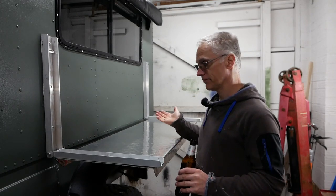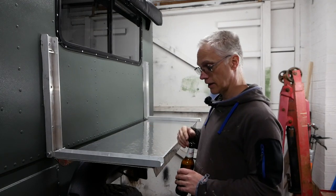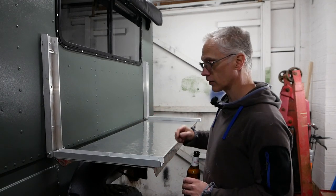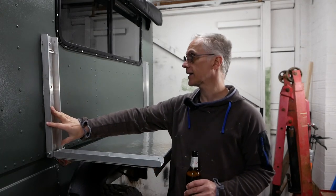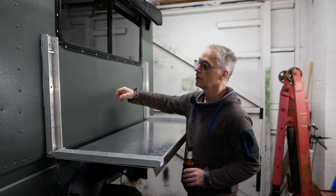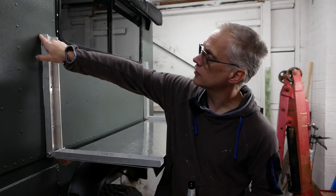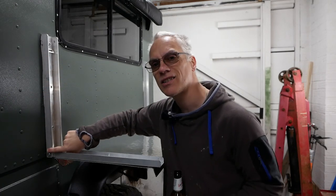So once I've drilled them, put that in, and measured the straps, I can take this apart and run the grinder over it, run a flap disc over the edges, so we've got a couple of sharp edges, round everything off. This piece is getting painted black, likewise as that one, so I'm going to cut this excess mastic off where it's come through, paint these black, and then I'm going to go down it with a new band of black mastic,